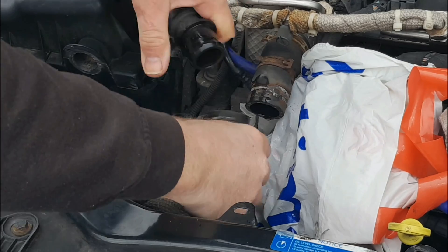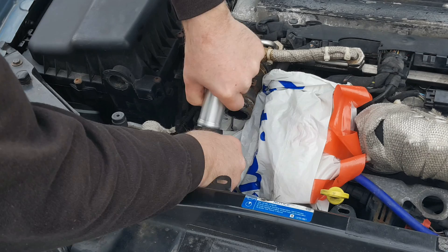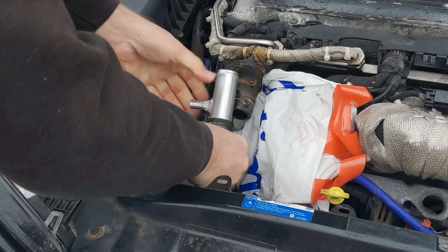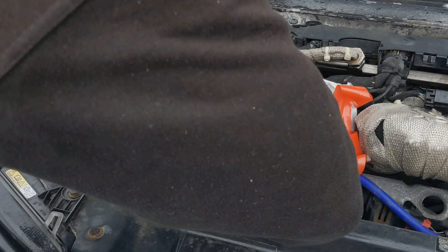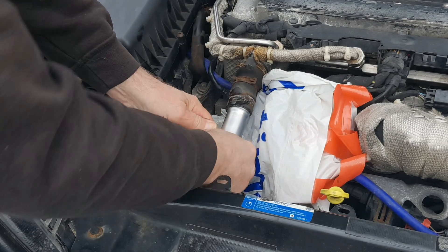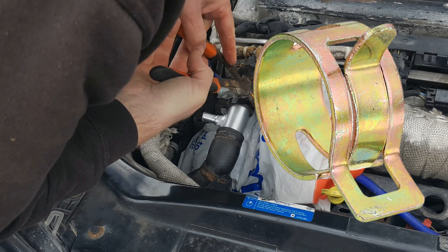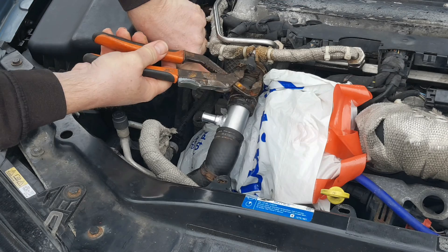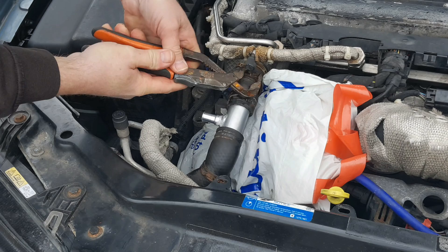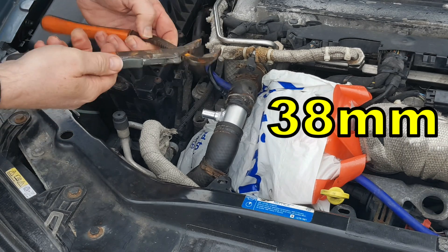You should find it comes out quite easily. It's then a relatively simple matter to just push the new T piece on - you will find that it is a bit longer than the original one. Obviously make sure you have pushed your clip on the top one. I'll put some links to new clips in the description. I bought my new T and completely forgot about the clips - I should have got new clips. If you are getting new clips you will need 38mm clips.